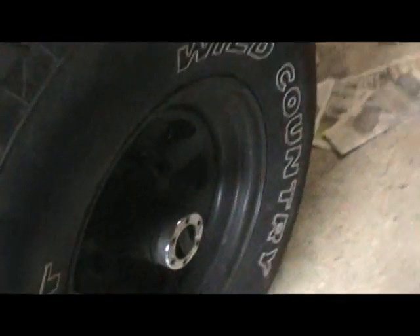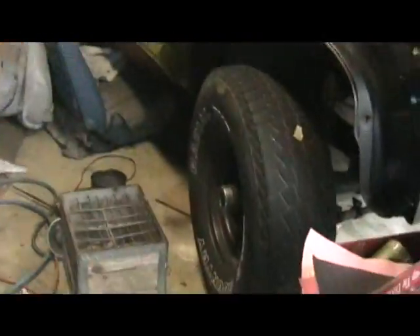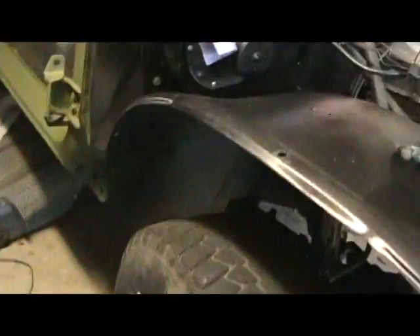The four-wheel drive does not work on this truck still. I know for a fact that the transfer case and the drive shaft are turning, so I'm thinking it's in the hubs. As you can see, these hubs are old and rusted, so I'm thinking it needs a new set of hubs. This was a converted transfer case, so who knows what type of conversion kit they used. I'm probably going to get into a mess once I get into it, but we'll get that fixed.